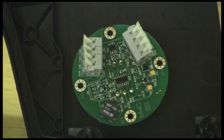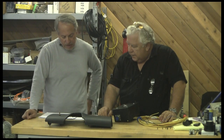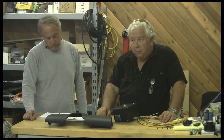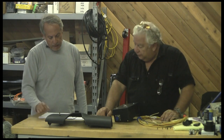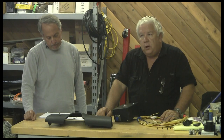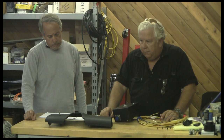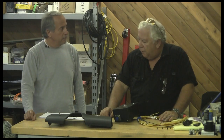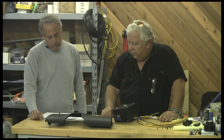On the traction battery we've got instantaneous voltage - that's our battery pack voltage - and instantaneous current in or out, which is how much current we're actually using: battery current while we're accelerating, or charging current while we're parked. And instantaneous power in or out as well. That's the magic of being able to detect the current. If you know the voltage and current, you can calculate and totalize in memory the amount of power in kilowatts - voltage times amps divided by a thousand. That's how we measure energy into and out of the pack; Victor's doing the calculation from volts and amps.